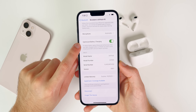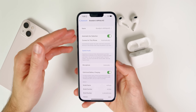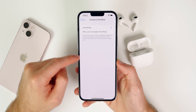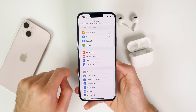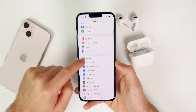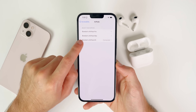There's also optimized battery charging for AirPods, just like on iPhone. Most of these settings will probably stay at default, but if you want to change the microphone setting or anything else, this is where you do it. You can also hear what spatial audio is all about here. A lot of people don't know there are more settings beyond the Bluetooth section — go into Accessibility settings and then down to AirPods, and you'll see your AirPods appear.